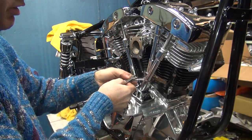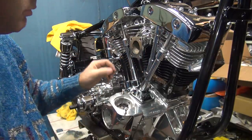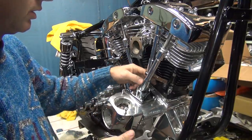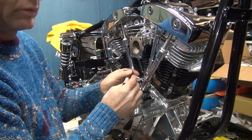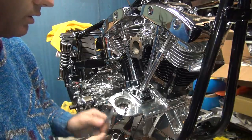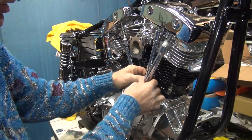So I'm going to go ahead and unadjust this one. This one is basically bottomed out. It loosened up to this point and it quit. So we need to get more. Back this one up 6 flats again. 1, see now we're loose. 2, 3, 4, 5, 6, and a little extra, 7, because that one was bottomed out also. And tight. Okay, so we're good to go.